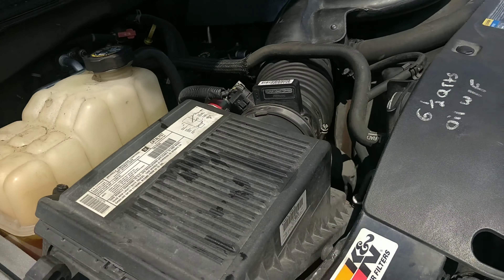Even the front here is completely dry now - it's not leaking. I think he'll be happy. So if that valley cover was seeping, it was seeping enough to cause it all to fill up. There's no other way for all that oil to get built up like that. See you guys later - hopefully this helped somebody.